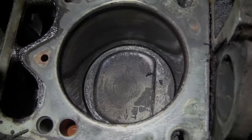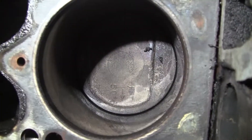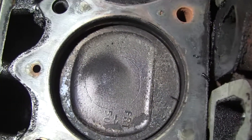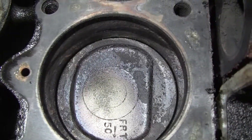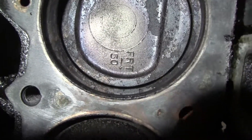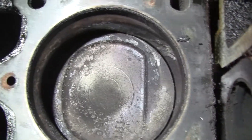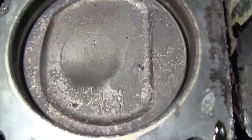I'm trying to provide a well-lit close-up of the pistons and cylinder walls. This is the front-most cylinder, number one. Carbon buildup is actually pretty minimal — not bad — and they're all about the same, which is a big deal.